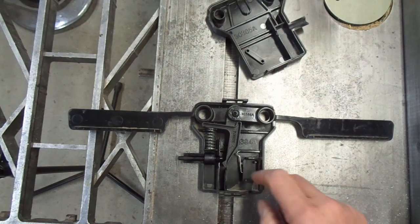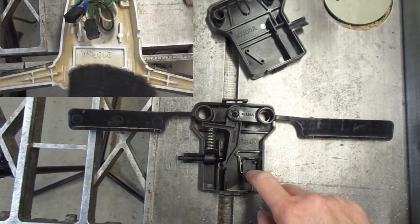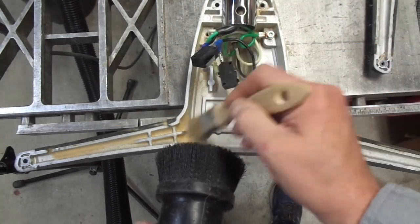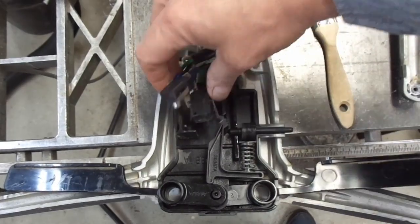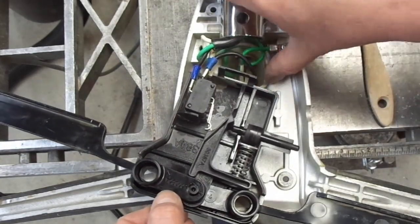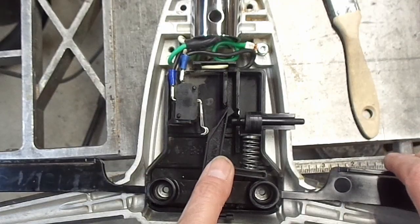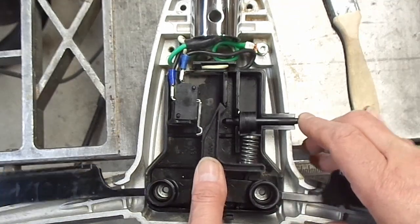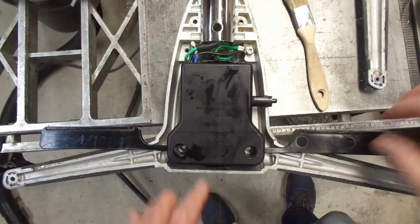I think assembly is going to be a little tricky, because I don't think I can get the wires on these tabs with the whole switch assembled. So I'm going to have to try to assemble the switch with the wires attached to the micro-switches in here. A lot of people would be inclined to just blow this out with compressed air, but I think that's just going to scatter a lot of dust around my shop. I prefer to use a paintbrush on the vacuum trick. I'm trying to use gravity on my side. Seems as though the switch keys on some bosses down here, and the wires seem to be cooperating. Seems kind of tight in here. I sprayed the inside of the lid, snapped it on, and it went without a hitch. Hopefully I didn't screw anything up.